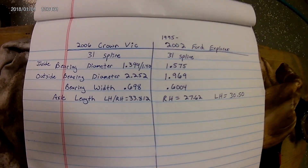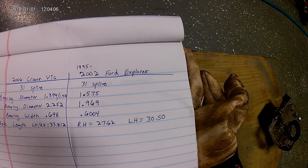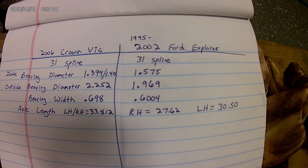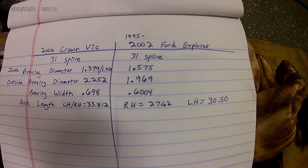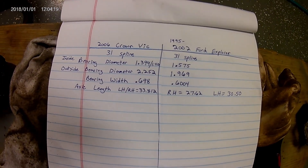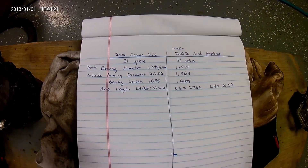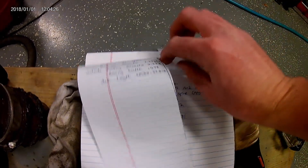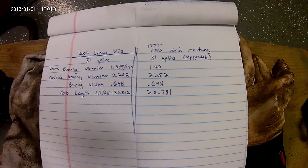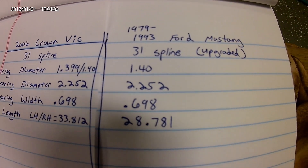Comparing those, the Explorer actually has a larger shaft versus the Crown Vic, and they don't make a crossover bearing anywhere in the world. I even had Benny Bullock at Crowe Burlingame in Stuttgart, Arkansas look that up for me — he couldn't find it, I couldn't find it, it doesn't exist. So I scratched that totally and went with the 79 to 93 Ford Mustang axles, which were factory 28-spline. Summit sells the kit.